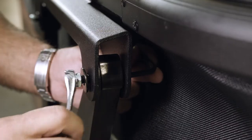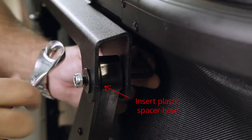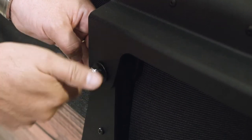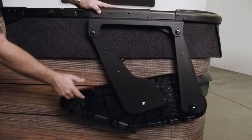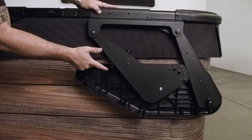Make sure to use the supplied plastic washers as a spacer between the metal plate on the pivot arms and the Vanish XL cover mounting bracket. Also make sure to run the bolts from the inside out — the lock nuts need to be facing outward. Do not over-tighten bolts; the pivot arms must rotate freely.